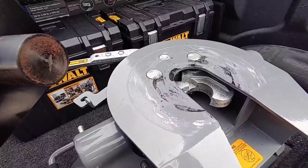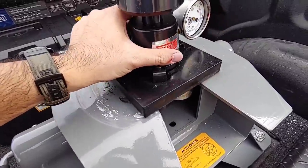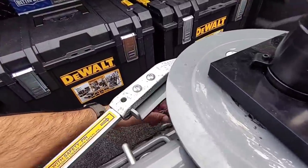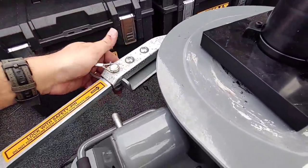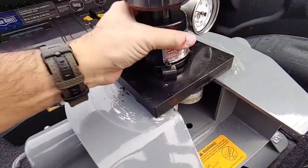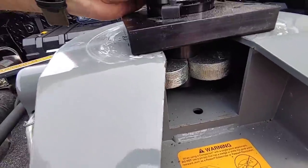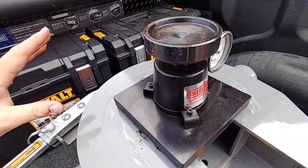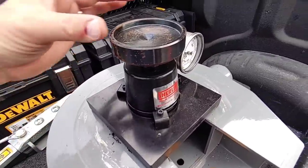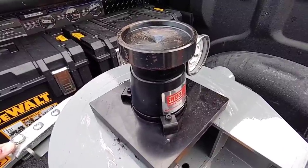I am in the bed of my truck at my fifth wheel hitch. I'm simply going to take this, drop it down, put this probably flat, close the jaws around it, and then pin the jaws in place so it doesn't come out. This is now clamped securely around it like a kingpin would be when you're completely hitched up. All I'm going to have to do is back this underneath the fifth wheel's kingpin and lower it down on top of the cup. This should be a relatively safe process — let's see how it goes.